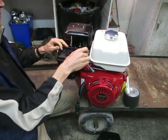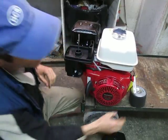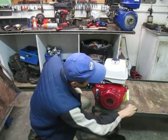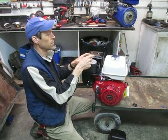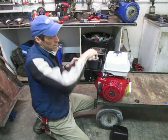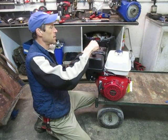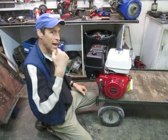Drop the air cleaner back on. There's a little location tab that goes down on here. Our rubber gasket was still in place, so that's good. We have an air filter servicing video on the Air Tools YouTube channel — you can watch that on how to properly maintain these two-stage air cleaners, meaning foam outside and paper on the inside — those require some oiling and proper maintenance. Turn on the fuel, choke it, and bang — the engine starts. And you're back in business. Thanks for watching.